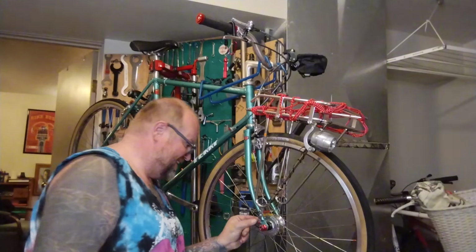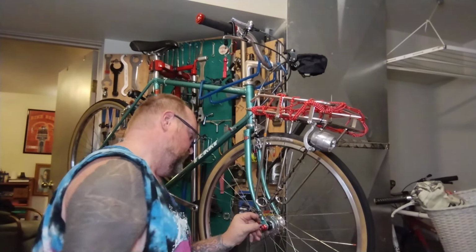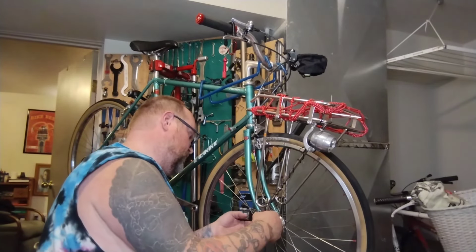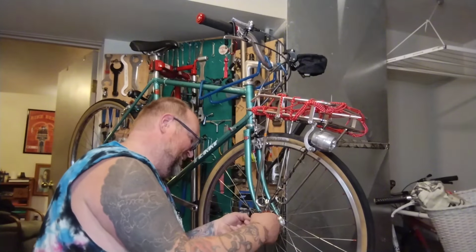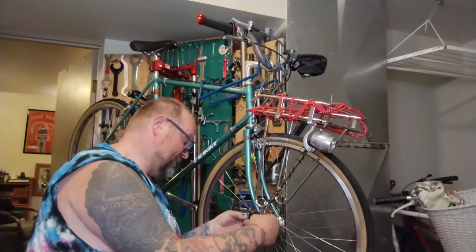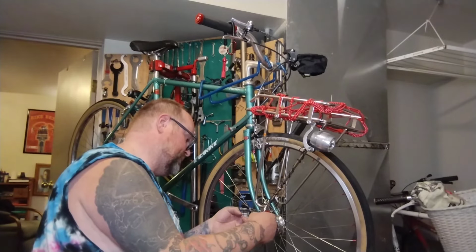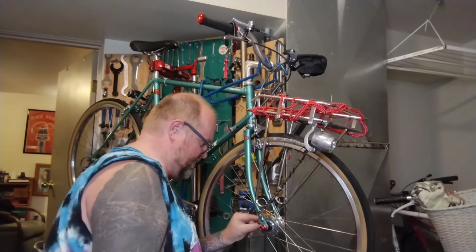Little bitty nylock nut. Now with nylocks, you need enough threads on the back. When you put the nut on, the threads cut all the way across the nut and all the way into the little plastic, which is the nylock. That sort of heats and expands and basically taps into that plastic, and then the plastic sort of shrinks as it cools and holds a nice tight bond on that nut so it can't come off.